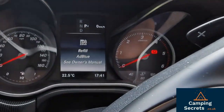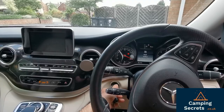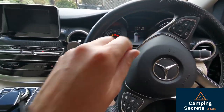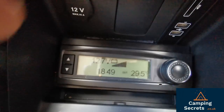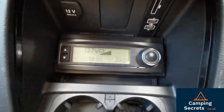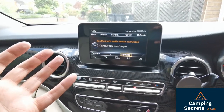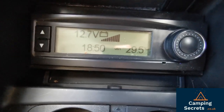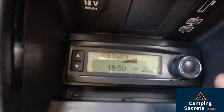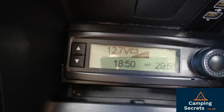Okay, it looks like we need some AdBlue — that'll be another video. So keys in: to put the roof up you need to be on position two — one turn and then a second so all the dash lights come on. In our version of the Marco Polo, we've got this little control panel, and all the camper van functions are accessed through it. In the latest versions it's all done via the Mercedes software called MBAC — Mercedes-Benz Advanced Controls. This 2018 model uses this little LCD display, and it does exactly the same job. To raise the roof, we just spin this wheel to show all the icons.